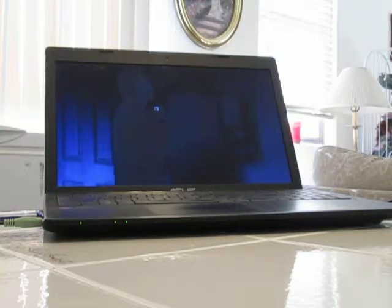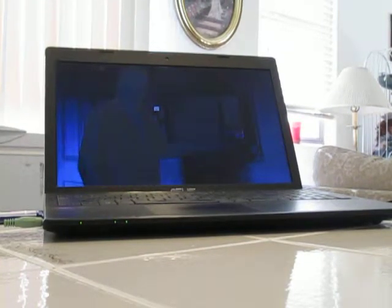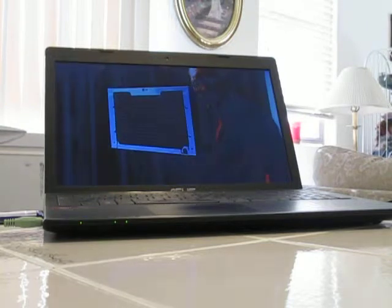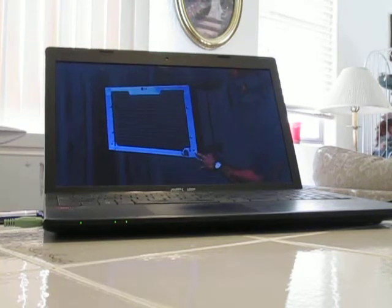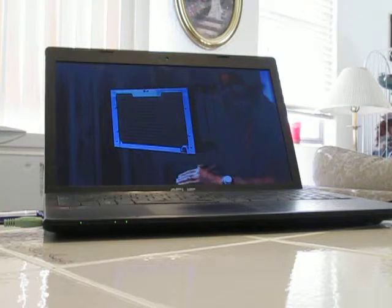Well, this is a brand new one, and it comes with an energy saving mode. But if you notice, the air conditioner is not really putting out that much cold air. There's a reason for it. I'll show you outside. All right. When you install a window air conditioner, make sure it's got just a quarter of an inch tilt, say from inside to out. Because if you don't, water will run inside your house.